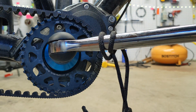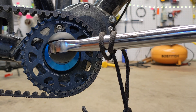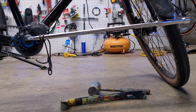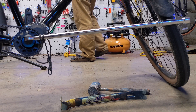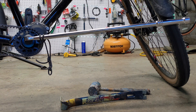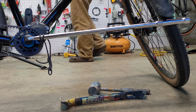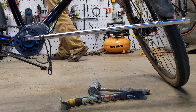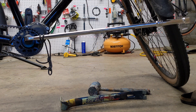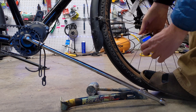So we've clipped in our half inch breaker bar two foot lever, and I'll go ahead and put an equation for force on a lever so that you can figure that out yourself. Knowing that a practical way to calculate the magnitude of torque is to multiply this two foot length of a lever arm by the amount of force we apply, we can get a good idea of how much pull we need on the bar to generate 42 foot pounds of torque — which is a good amount, so in general terms I'm going to pull decently hard on this lever arm, but not hard enough to break the part.